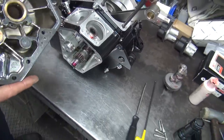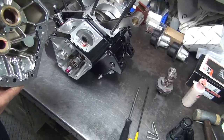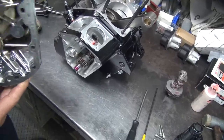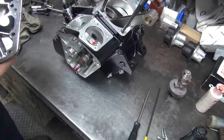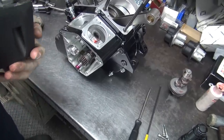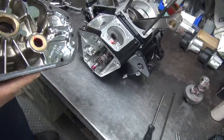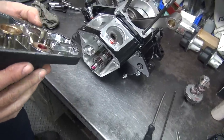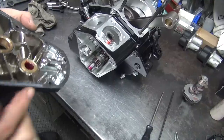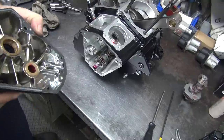And there's no way to taper that, huh? No. Well, tapering is caused by misalignment. So if it's bending the shaft that way, that's where you're getting that mark. Opening the bushing up isn't the answer. It's an alignment issue, not a size issue. I think most of our problem is down in this area.